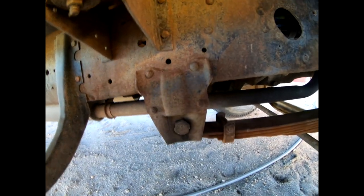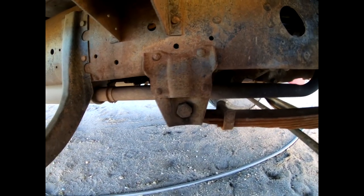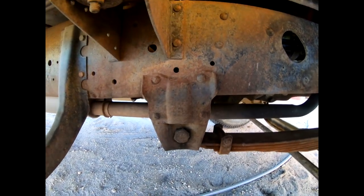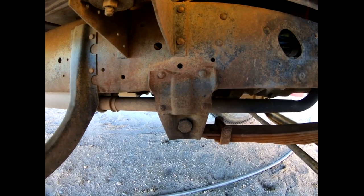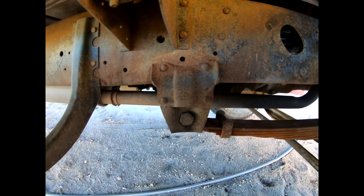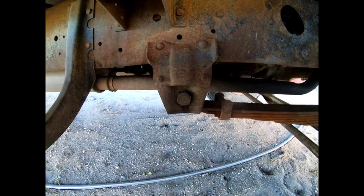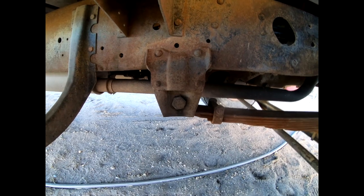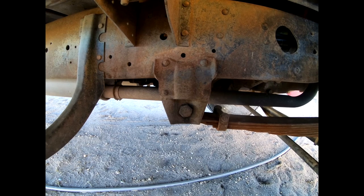Right there is Dumpy's rear end of the front leaf spring. At the top near those rivets it has been welded, because some time ago it broke, and instead of replacing it, they just welded it to the frame. It's got to be replaced because things are wiggling around on the suspension. That hanger's got to be replaced, and the one on the other side has got to be replaced as well. They're both broken. Before we can go haul timber up the mountain, we've got to fix these.